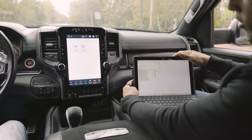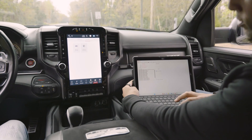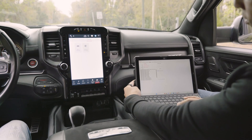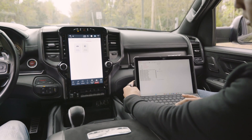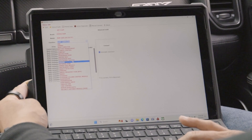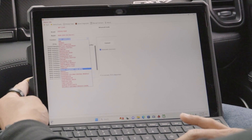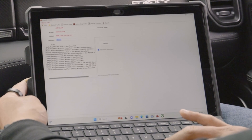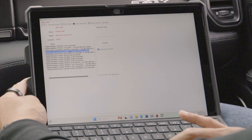We're going to start right after the point that you install your Central Vision Processing Module — the CVPM. Right after you install that, you're going to want to come into Alpha and connect into the radio, right down here. One of the options in here is going to be Central Vision Processing Module — you're going to click that.